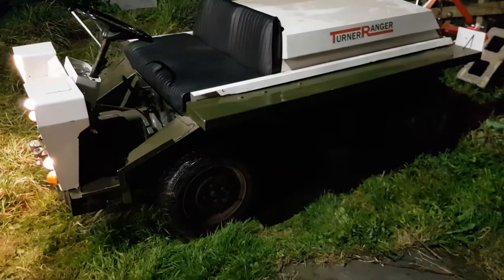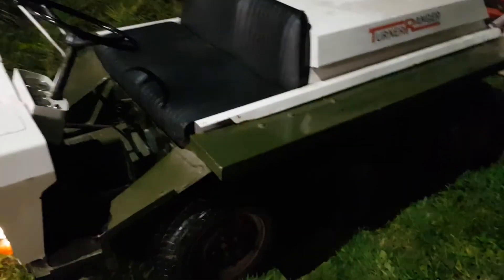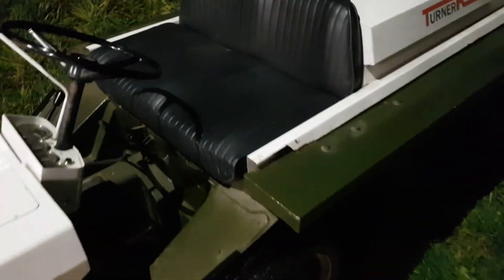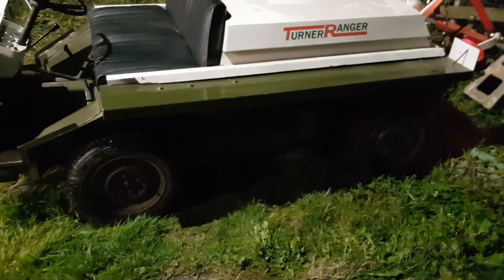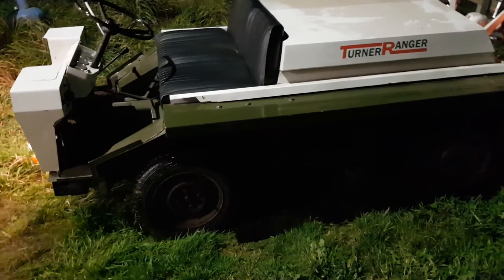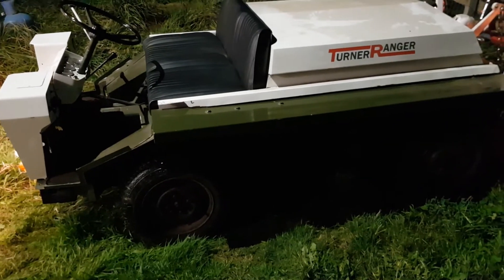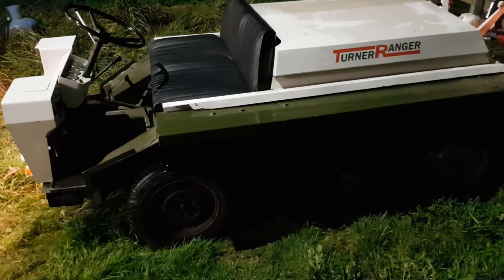It's obviously running. Still sounds a little rough, but it always has sounded rough because it's only got half an exhaust on it. If I give it a quick rev — must be a little bit of tweaking to the timing still required. I've just been using the little adjustment vernier on the distributor to try to get it back to normal. But it's running now, and it should be maintenance-free once the timing is set.